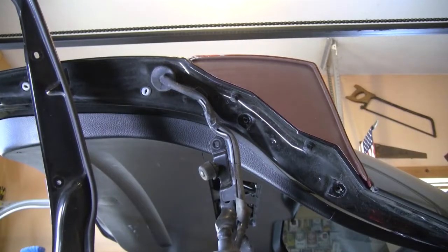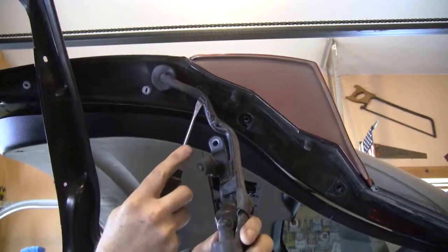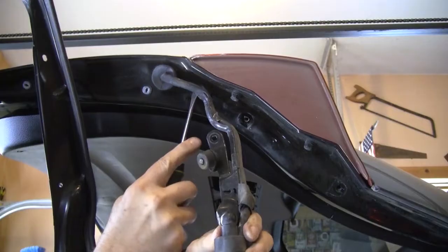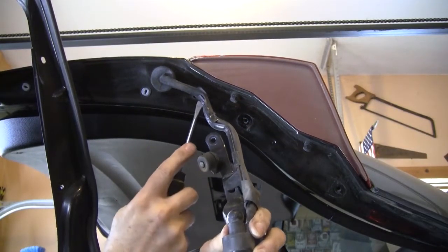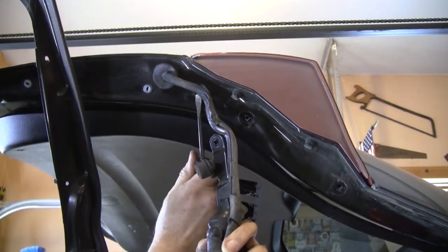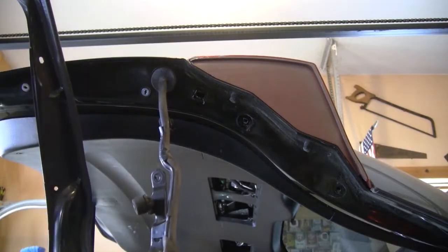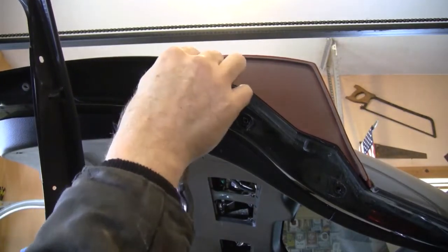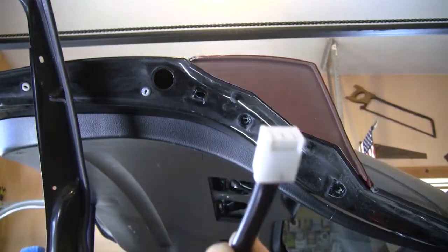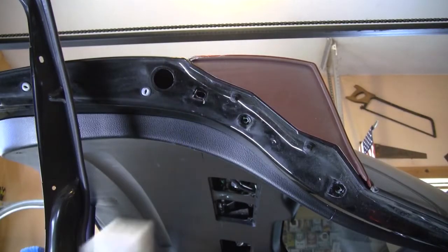Right behind the wire there's a little plastic harness. We're going to pull that out — just very gently with a screwdriver. Pop this guy out of here. Try not to mar your paint if you can help it. You can wrap your screwdriver with a little tape if you're concerned about damaging anything. There it goes, it pops out. We've already disconnected the wire underneath the plastic, so all we've got to do now is pop that boot loose and the whole piece pulls right out. It's just a little clip you hold in and it pops out — really easy, anybody can do it.